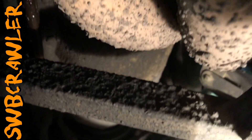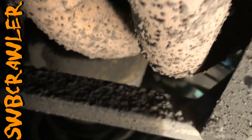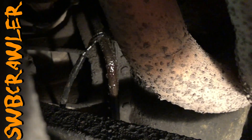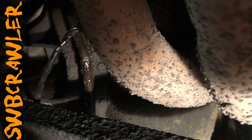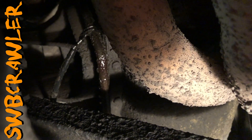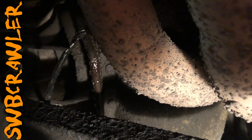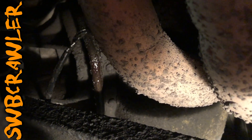It's really tight under here. See how everything has a nice coating of grunge all over it? A lot of this is mud on the skid plate, but see the arm up there for the skid plate? That's just covered in oil. I thought it was a valve cover leak, but it turns out it's the transmission lines. See how that line's all wet? That's one of the transmission cooler lines. I think that when I did the transmission, I was going to replace those lines, thought they looked okay, and didn't. I should have, because disturbing them made some little pin leaks — so when they're under pressure they started leaking. Jeep started smoking, not horribly, but enough that I noticed.